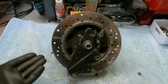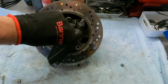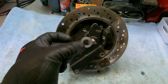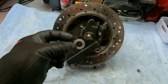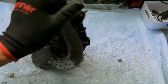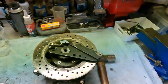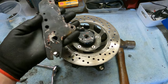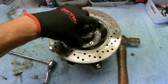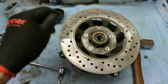So that's the wheel and tyre off the hub. On my particular one I've got a bolt going through at the centre — normally you'd have a shaft, but this has a bolt and a nut with a washer on each end. These washers are very important because they locate your shaft into the links — they've got to be the right washer, right thickness, right everything so it fits exactly. On this particular hub someone's modified it by drilling the back plate that links into the tab for the drum link and bolted it to the speedo drive. The speedo drive comes off, but I'll need to give it a clean because that grease in there is about a million years old.